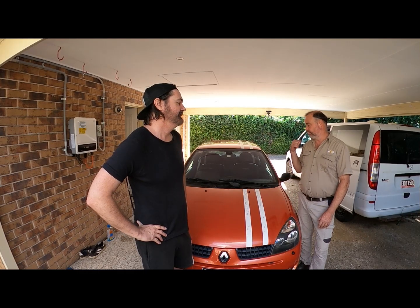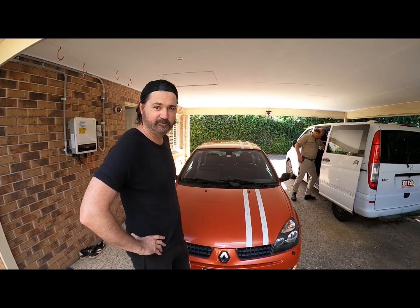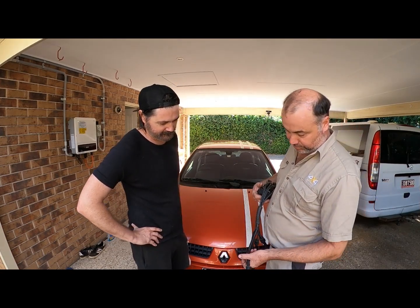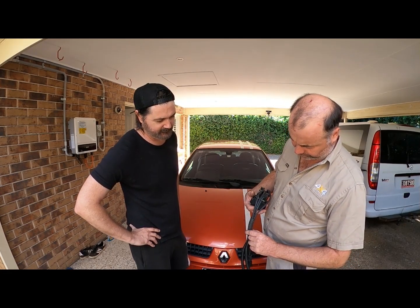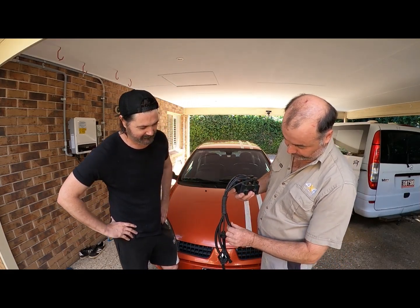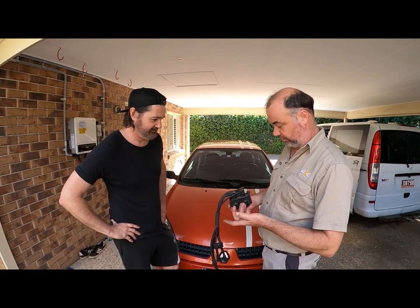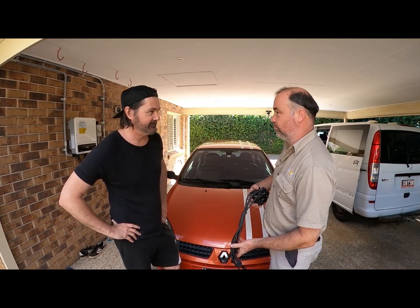So I've just brought the whole set. This is a brand new set that I put on my race car. It's off the road, as you may know. One of the features that I do is I get the split conduit and lay a split conduit there, which you sometimes find that they do. I think that might even be the genuine one, but I added additional split conduit further down the line, just to give you a bit more insulation between rub points and contact. Then I've just left it on this coil pack. I know the coil pack's good. I know it's all set up, so it'll just make fit up 20 minutes easier.